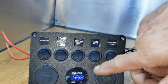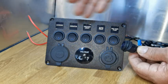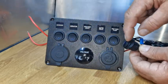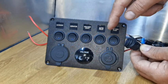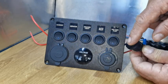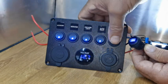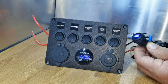You turn them all off and check if you've got voltage there. If you turn the isolation switch off, you've now isolated that switch panel — nothing works. That's what someone was asking — could I isolate the panel separately. Using one of the panel switches for that is tricky to figure out; if I do I'll let you know in another video. But if you can just get a dedicated isolation switch, I'll put a link in the description.